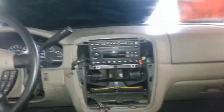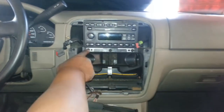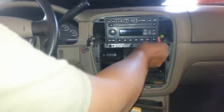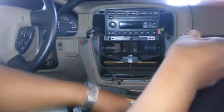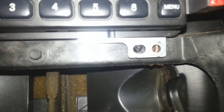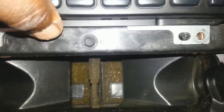The radio — I'm assuming it's a factory one — has no screws on top, just two right here and some guide pins. I'm going to use my 9/32 socket drive to take those out. I've already pre-done this for you so it'll be faster. Just to show you the detail, especially when you go to put it back in — see that little guide pin there? There's another one on this side as well. When you go to put it back in, make sure those guide pins line up your radio, then your screws go in the other holes.